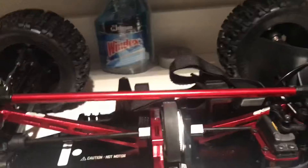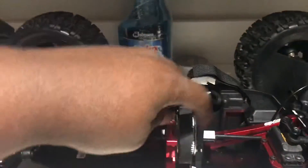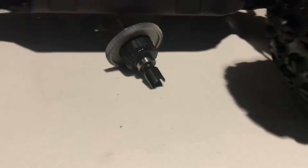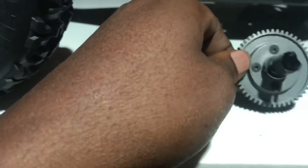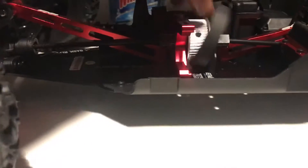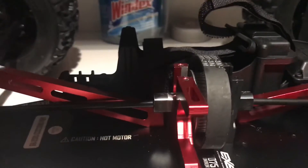Already pre-testing it out, I thought I'd shoot a video. Right now I got the 45 on there with a 200 millimeter belt. This truck comes with the stock piece, so I took that out. I got some shim, dropped this 45 in here with a 200 millimeter belt. It's rolling smooth - it was easy. I have this shaft from the limitless in here. I've been switching back and forth from the limitless to the felony. Works in the felony, works in the limitless, but the cups are not right. The cups came from my Arrma GTB - I had to use the spool from them. So I'm gonna have to change the cups out - that's the only thing I'm gonna have to do because they're kind of rubbing.